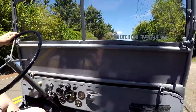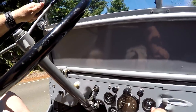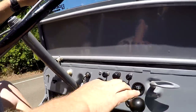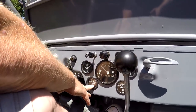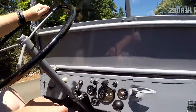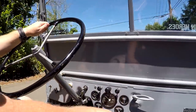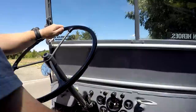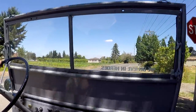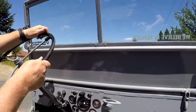I just wanted to show you while we're driving - you can see the speedometer's working, the odometer's going to work here in a minute, fuel gauge isn't working, oil pressure's really good at 40, temperature looks good, and the ammeter works. Most stuff's working there. I'm not 100% sure what's wrong with the fuel gauge. Obviously no wipers, but those are easy to put in if you wanted to - though you're probably not going to be driving this in the rain. You can hear a little bit of whine from the transmission.